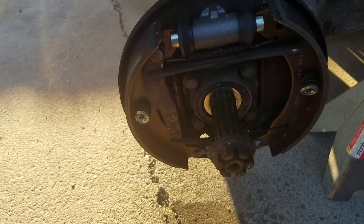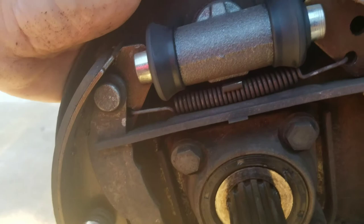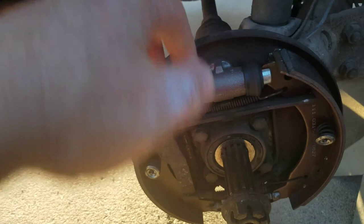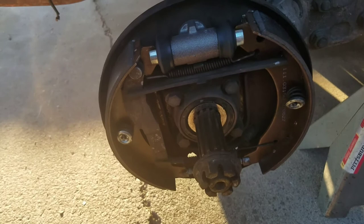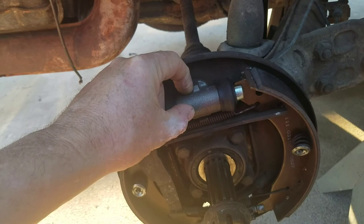They also didn't change the shocks, so this thing would buck and slide all over the freeway. This side looks different because the mounting bolt is oriented differently, but it's the same one-bolt setup. I'll probably recycle these for a pan buggy build — something from Mad Max — since I have so many belly pans and transmissions piling up. I could have swapped in bigger wheel cylinders and a bigger master cylinder and probably really improved the braking power. Hopefully you guys can learn from my mistakes.